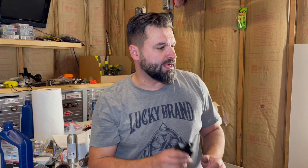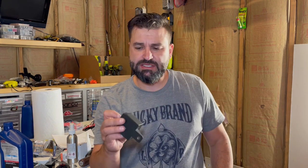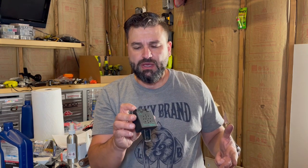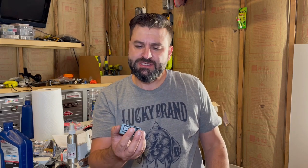The other thing is the chime. This is something that I didn't realize I had an issue with until I started removing the old fuse box, because this is positioned under the passenger footwell. This is the chime for the seat belts, doors, and I believe key in the ignition. One of the wires that powers this is that pink wire that had the bad crimp on it. But that didn't fix it either. So this is just constantly on. You start the car, you're driving, and it's still on. You have your seatbelt on.